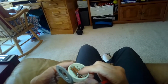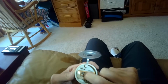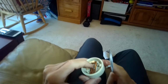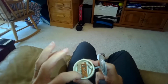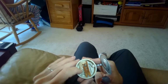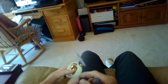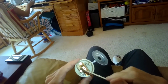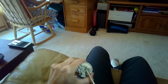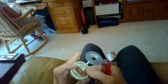So you get enough pressure built up in there, and it's going to let that close, and that's going to lift up. You can even hear it click. Lift up, and that's going to let that terminal and that terminal close, which is the ground. Oh wait, is that the ground? What is that? It's going to let this one, which is the middle terminal, and that one, which is the first terminal, close that circuit.